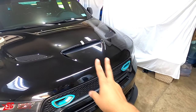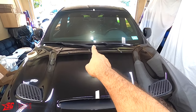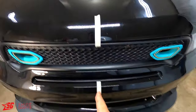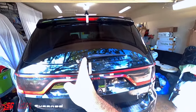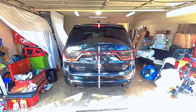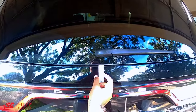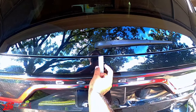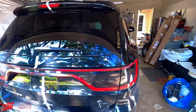I'm ready. As you can see I have my tape in the middle - there's one over there, there's another over there because there's a sensor on the inside of the windshield, so that's the center. I have one on the roof and one over there. For the rear I have the tape marking the middle of the truck. That's my guide for the stripes - I'm gonna keep the stripes the closest I can to the tape. This is a one inch gap. I always like to have about an inch or inch and a half gap between the stripes.